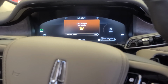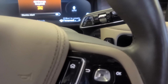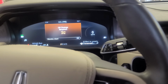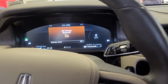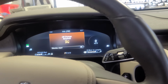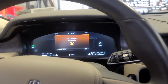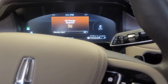Okay, we start the vehicle. Well, let me give you a rundown about the oil change. You go to the bottom looking for the oil drain plug. You're gonna see this panel that covers that section, and you're gonna see these clips. I'm showing you how to remove those, and you also gonna see these bolts that hold the panel. What you're gonna do there is use a 7mm socket, okay? A 7mm socket should do the work.